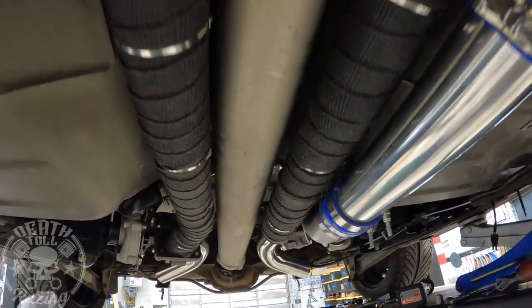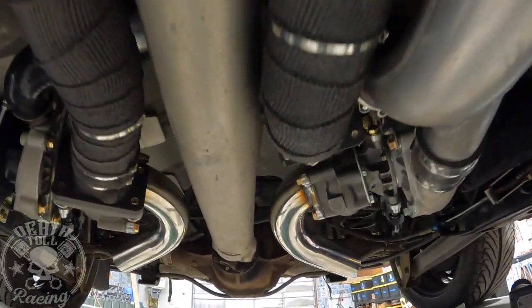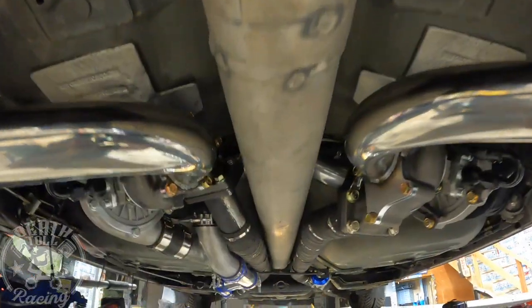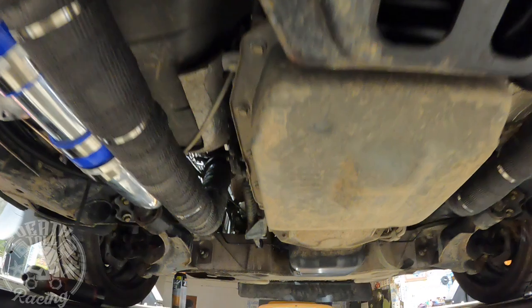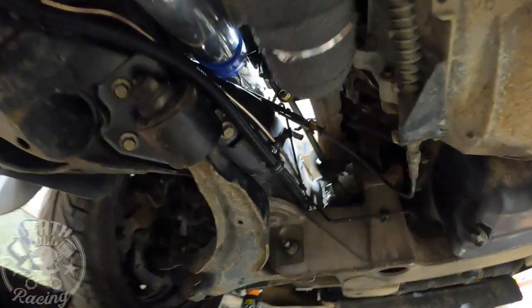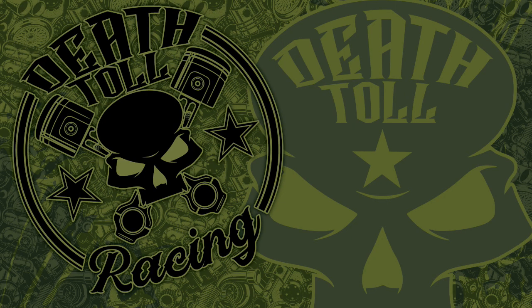If you're wondering, the driveline does clear in all situations — I played with jacks making sure the driveline is never going to contact the exhaust. We also still need to make a plug for our third wastegate hole that we're not going to use, and maybe in an upcoming 'see if it works' episode we'll try running a single wastegate for twin turbos.